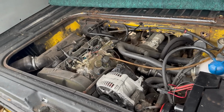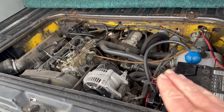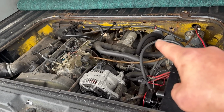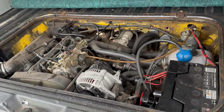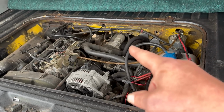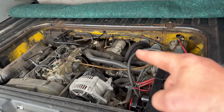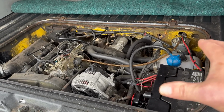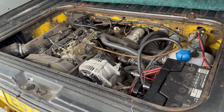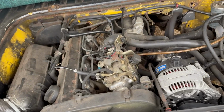It's not the fastest. Originally it was a 1.6 non-turbo engine in this van, so it had the very low geared 1.6 gearbox, which was pretty crummy on motorways. So I had an ABB gearbox from a petrol van fitted, so it's much longer gears now, and the engine's a lot happier without it revving its head off the whole time. But as you can see, there's lots of room in there. It's very, very simple.